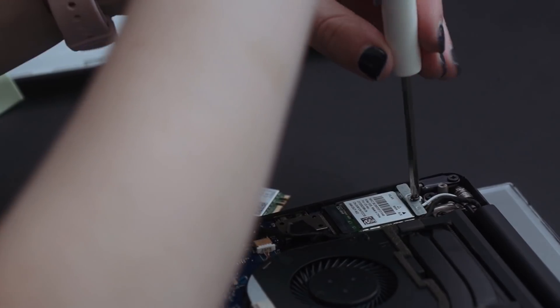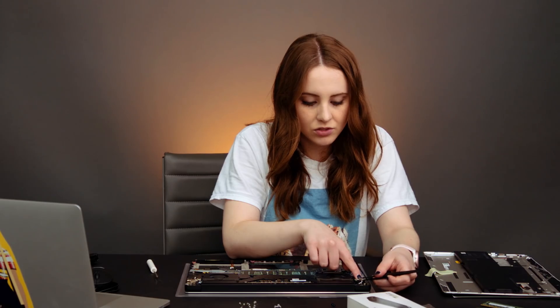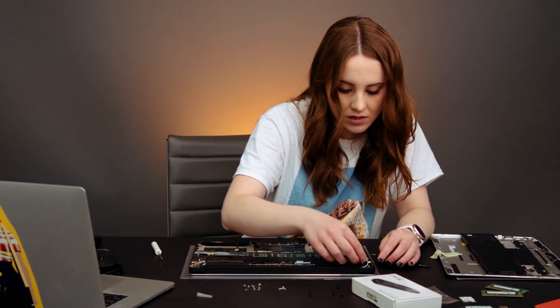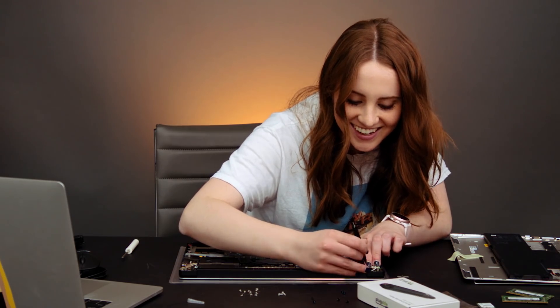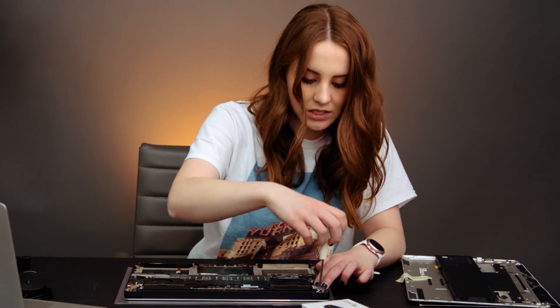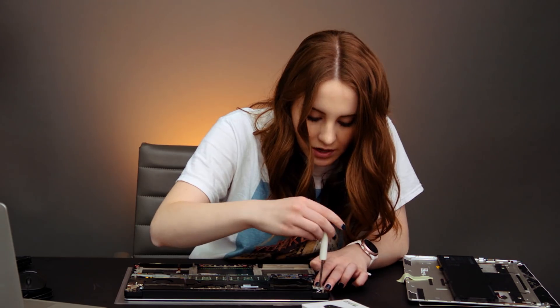The Wi-Fi card is the last step, so we're just going to take one more screw. White cable on the left, black on the right, so it's kind of just like an up motion. This is so nerve-wracking. Insert this in. Must be nice for normal people who can do this stuff without worrying. Well, that was easy — it's easier using your fingers. Getting those antennas on were a little bit more difficult than I thought, but that's okay. So we're just going to screw the cover back on.